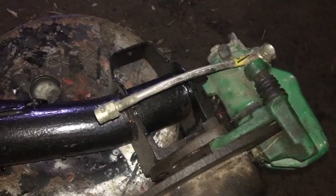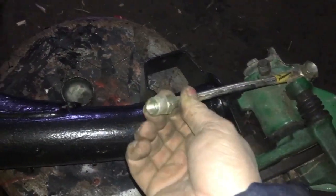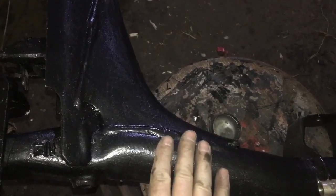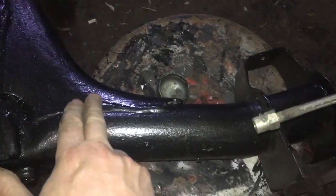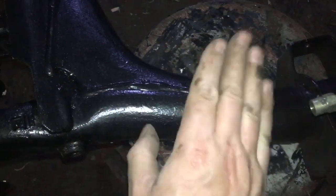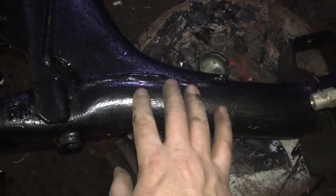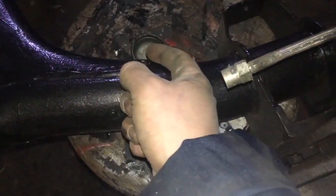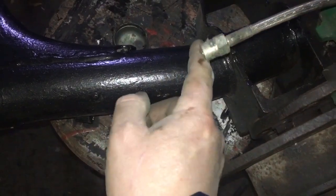I have to get new pipes all made up — I'm gonna make them in copper and run them all the way down. So that's the brake line, they obviously just stop here. I'm gonna wait until the rear axle is bolted to the car and I'm gonna take them from here. They'll probably run down this way, over this way. I'm gonna keep them maybe either tight in here or tight this side, so when the rear axle is going up and down there's less chance of it getting crushed.